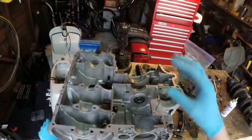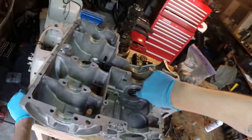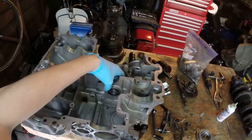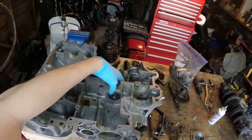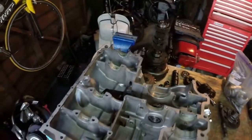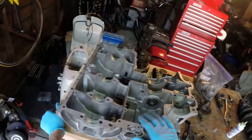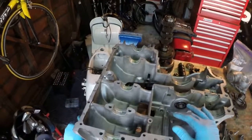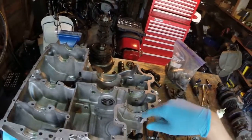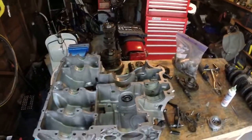So that's kind of the background. A couple of things are already installed: the primary chain tensioner is already installed, and there's a transmission bearing already installed here — it's a real pain to take it out, so once it's installed you don't really want to touch it. To take it out you need a slide hammer and a bearing puller. The bearings are installed already as well, and once they're installed you don't want to mess with them because you'll scratch or damage them and they'll wear at an irregular rate. This green slime all over the half-circle journals is just assembly lube — it preps everything and gets it ready.